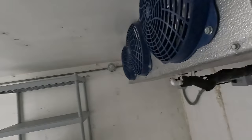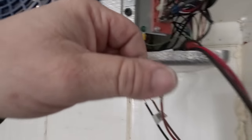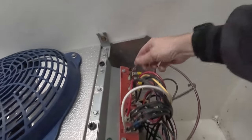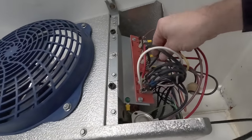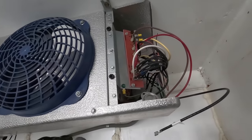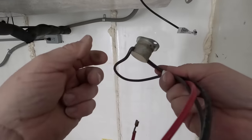Let's go ahead and grab this out of here — take that one out, got the screws out. There's the control, wire tied in there. Brown's up here on X — we'll hook the new one right there on X. Red on in, cut on in. And finally black, which goes down to F for fan. Let's go ahead and remove the old one. You can tell it's an older one because now they all come in at the top, so it should be a little bit better.